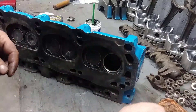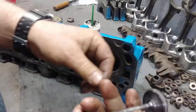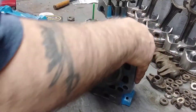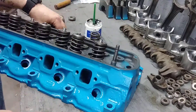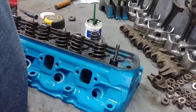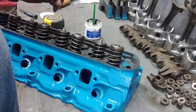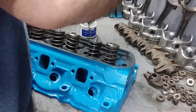This is nice. That will guarantee me that the valve is going to close and won't leak. Now I'm going to put this valve stem oil seal right here — there you go. I got my spring here and the retainer, whatever you want to call it.